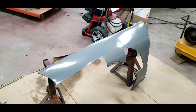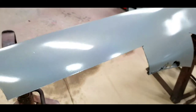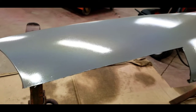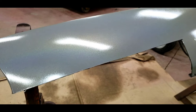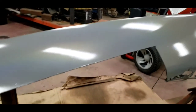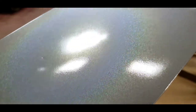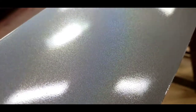Here's what's left of the fender. I did very minimal prep — just a scuff pad and cleaned it up a bit — then laid down the gray paint, wet sanded, and top coated with that Color Effects. I think it turned out pretty good. It's really hard to tell in this garage, but you can see that metallic color shift going on.